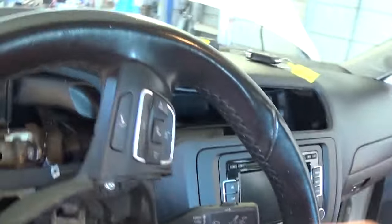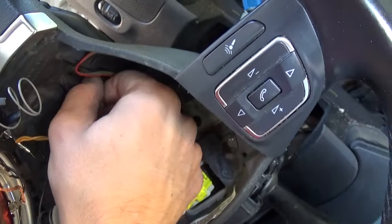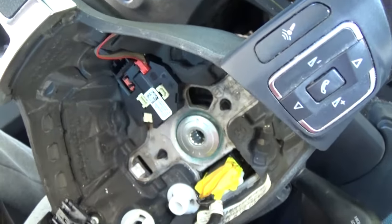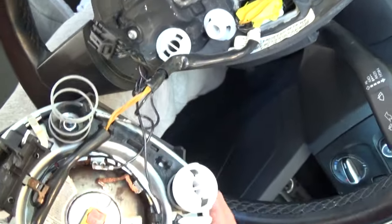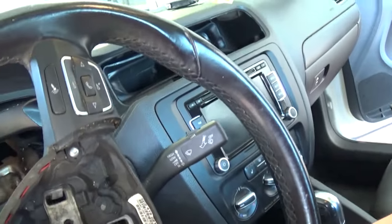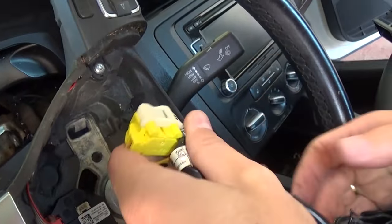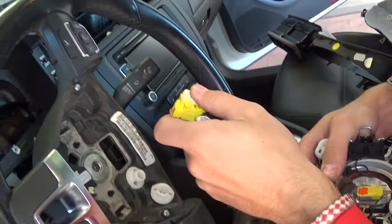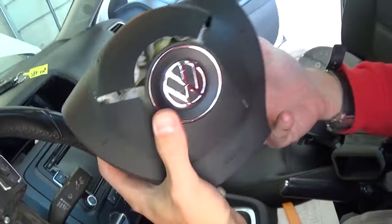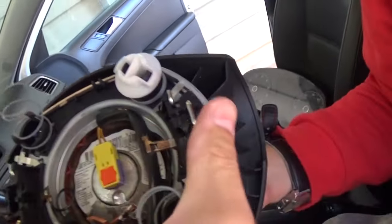There is a wire that you need to press down and pull. You press this one and you pull. After that, we have the wiring for the airbag — you want to make sure your battery is disconnected at least 30 minutes before you mess with those things, because they could be very, very dangerous. This connector you remove by pressing up, sliding up, and it comes out.